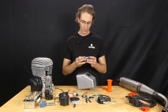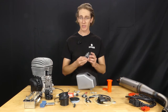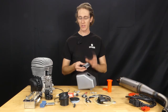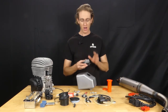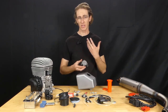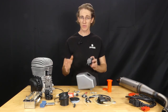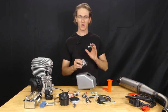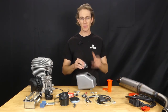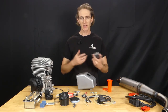The fuel pump for the Mini-Rock is a Dellorto style fuel pump commonly seen on shifter karts and most of the Vortex Mini-Rock line. One thing worth noting is that very commonly on the Mini-Rock a return line may have to be routed if it oversupplies fuel to the engine, which can cause it to bog or create other issues. Also expect that when you purchase your Mini-Rock engine you may want to invest in a rebuild kit, as two-cycle pre-mix fuel can get into these if they're left to sit and can get a little gummy — something you might want to consider.